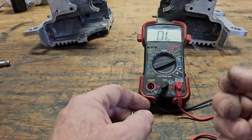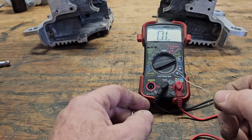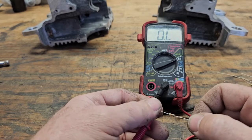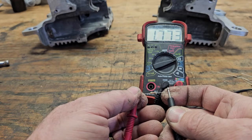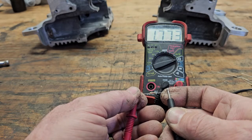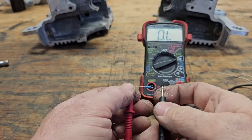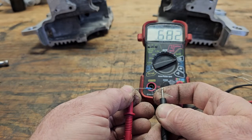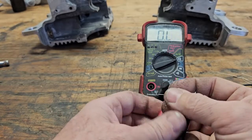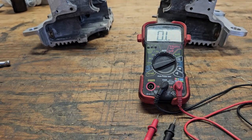You want to get the resistor that is closest to what your key read. You can get one of these kits, or just measure your key and order the exact resistor you need - go to Radio Shack if you still have one. Make sure you understand what you're measuring. This one reads 1.773K, that's 1,773 ohms. For example, another one says 0.682K, so that's 682 ohms. If it didn't have the decimal and K, say it read 170, that would just be 170 ohms. Get the resistor as close to yours as you can.